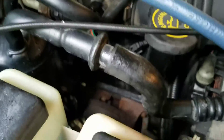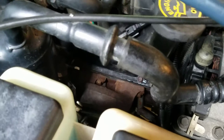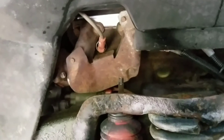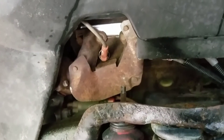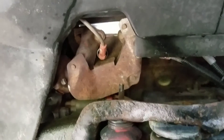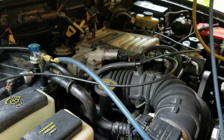First thing I had to do was over on the passenger side. If you've seen my earlier videos, you know that I replaced the exhaust manifold on both sides with new gaskets. Over on this side I had a leak develop over the winter, so I went ahead and got some of the Percy's oval port gaskets — worked pretty good — and replaced them again and made sure everything was sealed up good. Hopefully I won't have an exhaust tick now.